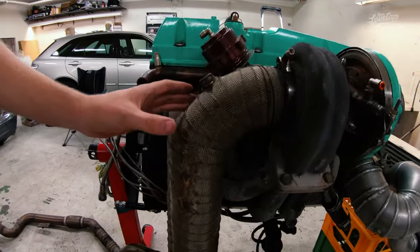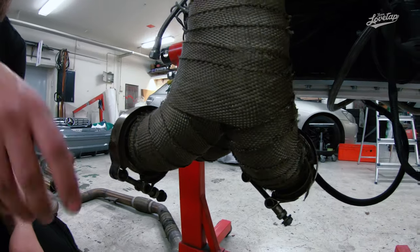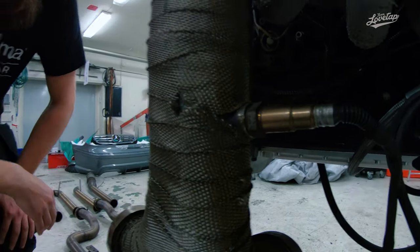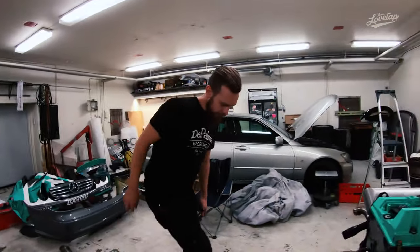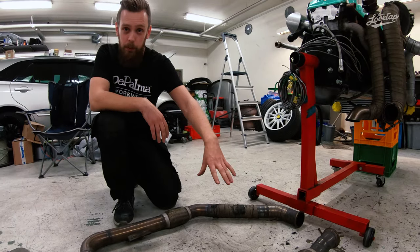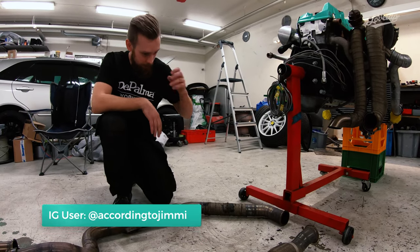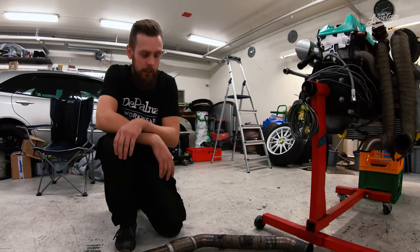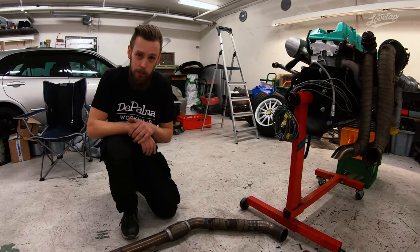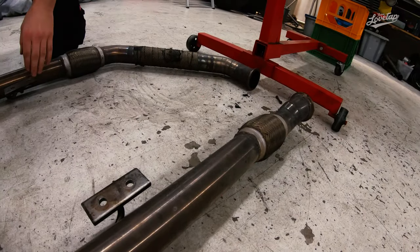The downpipe is really custom — it's a three-and-a-half inch downpipe that comes down and splits into two-and-a-half inch pipes. All of this is stainless steel and heat wrapped. We also have our lambda air/fuel ratio sensor here for the ECU. The two two-and-a-half inch stainless steel pipes are made by EEC Karlsson steel design, with help from my friend Jimmy. We went with this mainly for ground clearance — the car was built for a V8 and has tunnels underneath that make it fit very well. It's connected by V-band and has flex pipes on each side to prevent cracking the manifold.